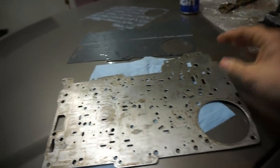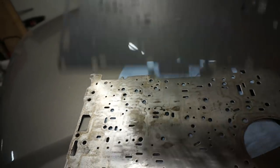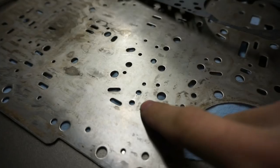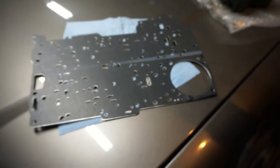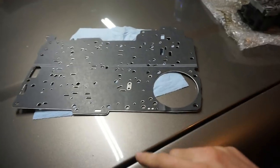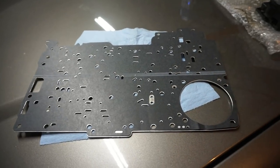And then if I flip this over and take the other gasket, I put it over the top here — you can see this one has the little outline around these two holes, and that's where this one's going to go. So this gasket is for this side, the other gasket's for the other side. What I'm going to do now is take some transmission assembly lube and put some on the bottom of this gasket and stick it on.